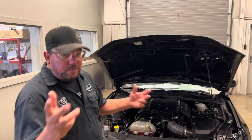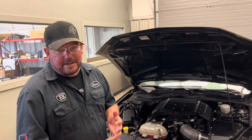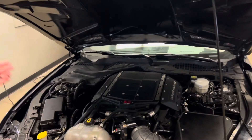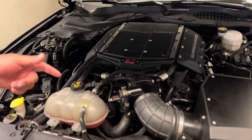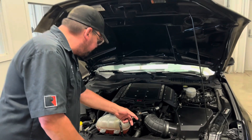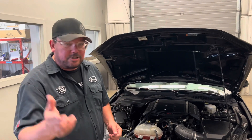All right, we're going to go down and take a look. Here's what we have going. I want to talk to you about the boost on this car. We're on 93 octane, manual transmission. It's a 2650 supercharger — it's the E-Force. I know it has a Saleen logo, but they just put that on there to make it look like it's theirs — but it's not. We have the 103 throttle body, the E-Force 113 air induction system. This does come with a fuel pump booster — it's kind of what they call their stage two kit.